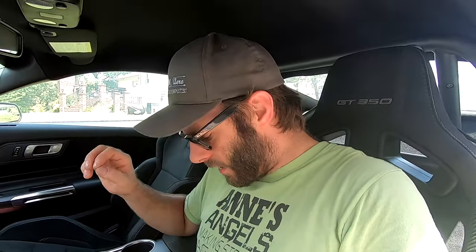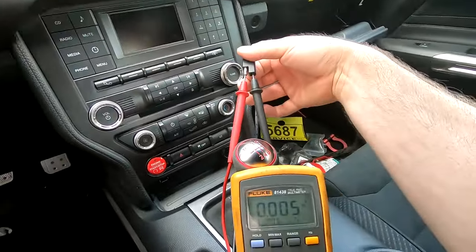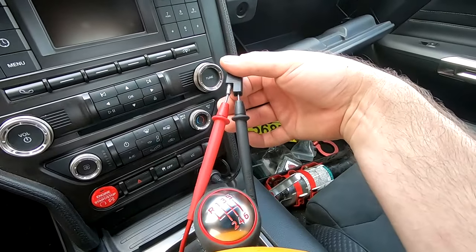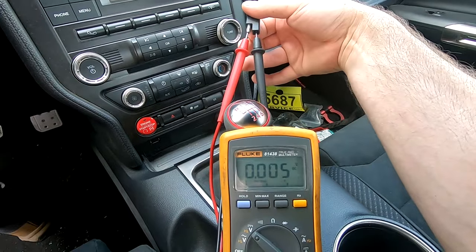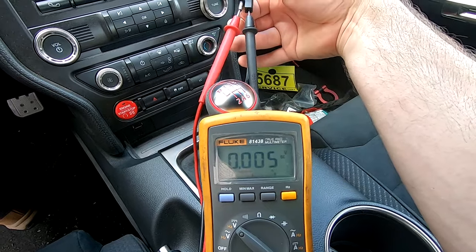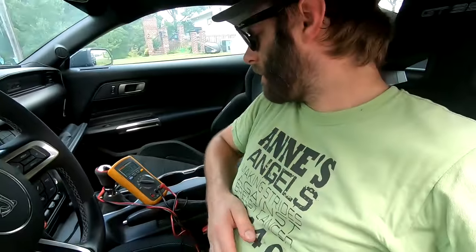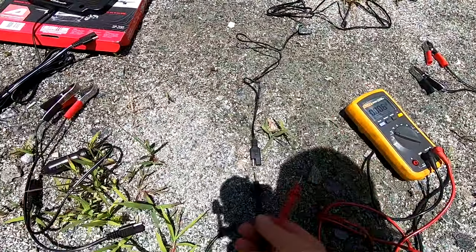I think it's because I was just in here a few minutes ago. I checked it when I very first opened the car and there's some sort of timeout thing - in case you have something plugged into the cigarette lighter, it works for at least a couple minutes after shutting down. But I'm almost positive they don't work after that. You can see after the car has been sitting 10-15 minutes we're at 0.005 of a volt, so that's why we couldn't use the cigarette lighter.